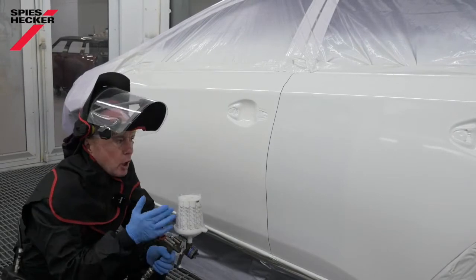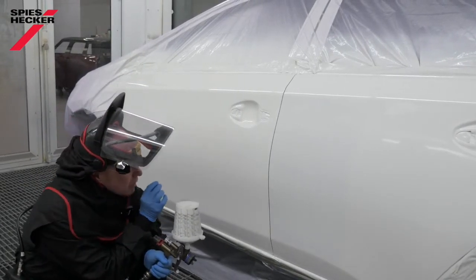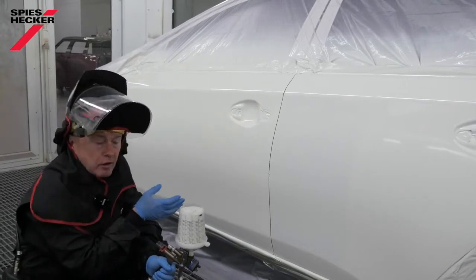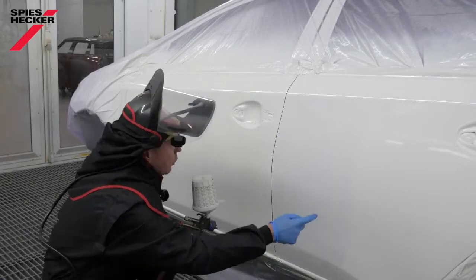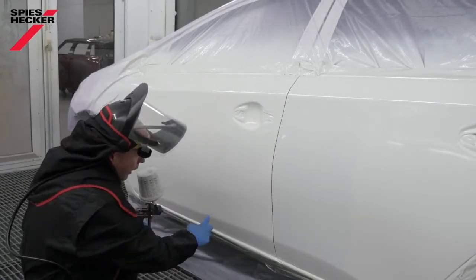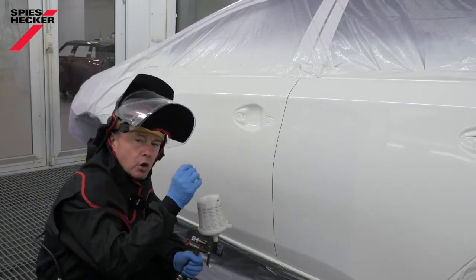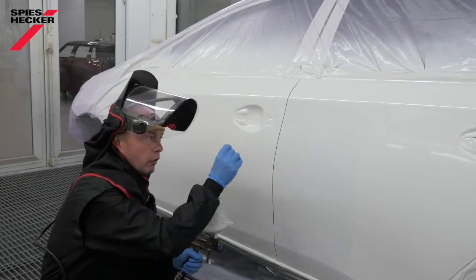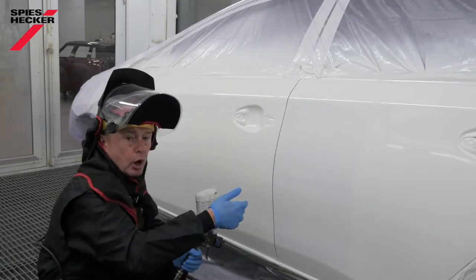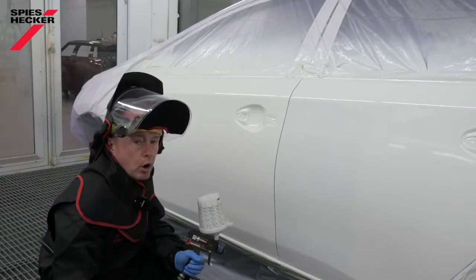Normally this would be, as you know, in a 1.5 coat continuous process. But I just wanted to take the time to see, is there a difference? And quite clearly, I can still see the grey surfacer or filler underneath, whereas the white is obliterated in the first coat. This means, of course, on the white, I'm only going to need that half a coat more. On the grey, I might need to apply 2 coats, meaning I'm going to use more base coat and meaning more cost.